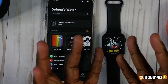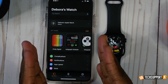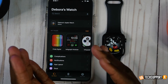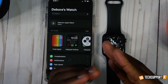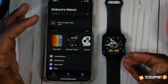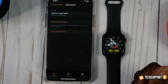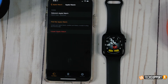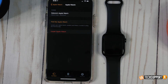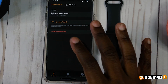If that doesn't work, the next step is to unpair your watch — but be prepared that once unpaired, you'll have to repair it from a backup or start from scratch. It's not a simple step, but it does definitely help with battery problems. To unpair, go into your Apple Watch companion app, tap the watch, tap the little eye icon next to it, and select Unpair Apple Watch. Go through the unpair process, reboot both your phone and Apple Watch, then try the repair process again and see if that helps.